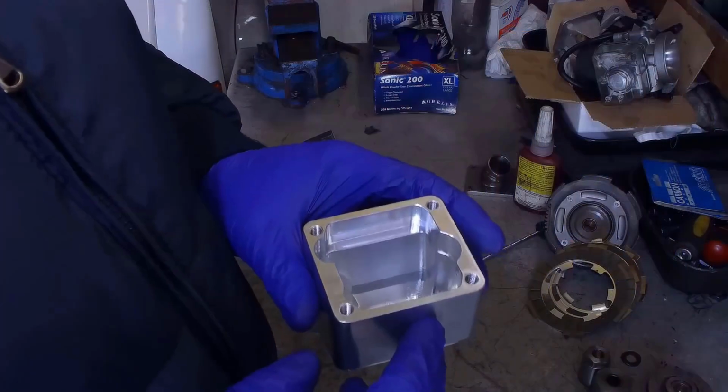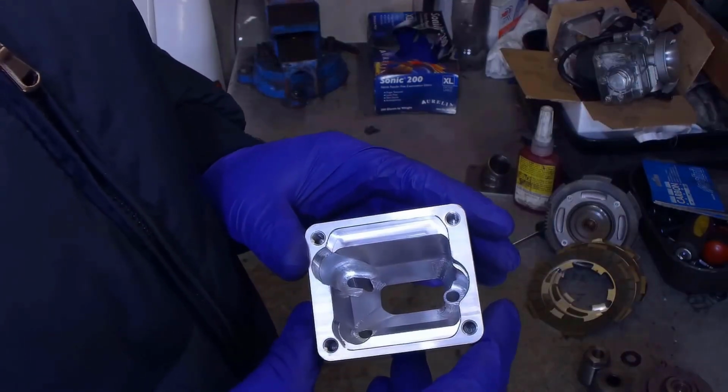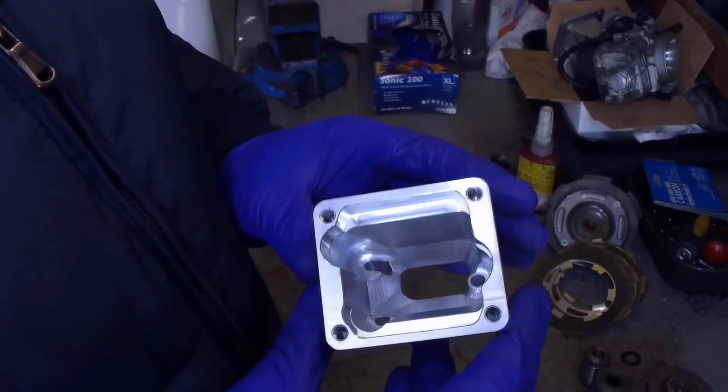Regarding the reed valve pack, I chose an MRP collector suitable for RD350 reed valve packs, which I deemed fit enough for the 28 VHST carburetor that we'll use. Let's go check this MRP reed valve collector. It's a very nice object. It's almost a shame having to mount it on the engine.